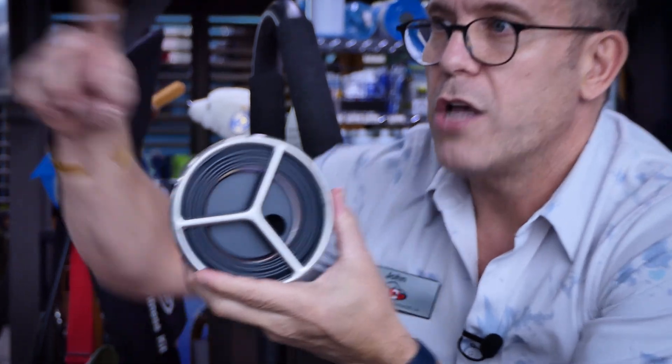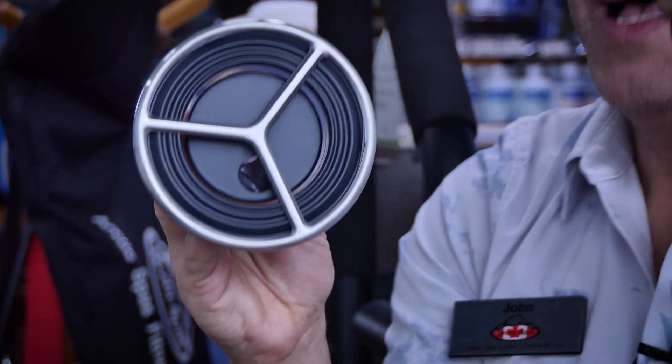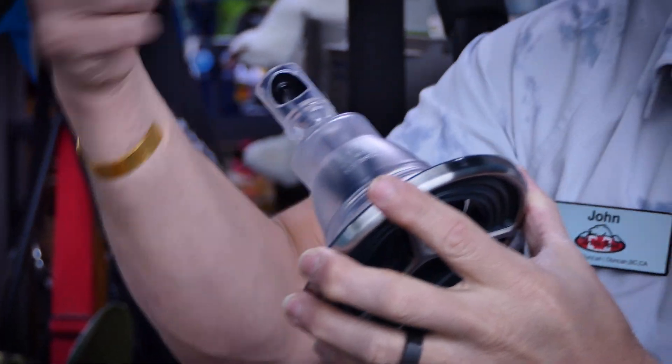It takes less energy to cause our jet to spin. Why is that important? The more energy it takes to spin the jet, the less force you're going to get when the jet does the massage on you. So we want as much of the water pressure and as much of the impact to be on you — we don't want it used just to make this thing spin.